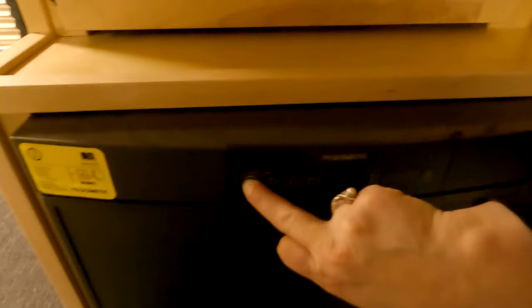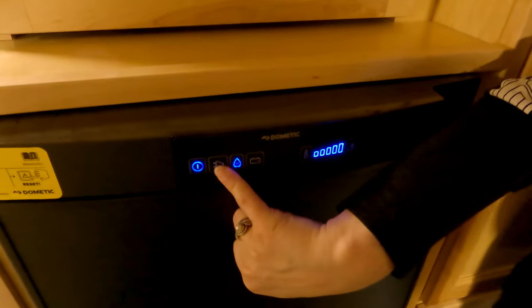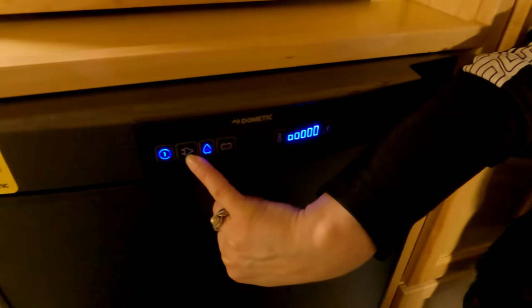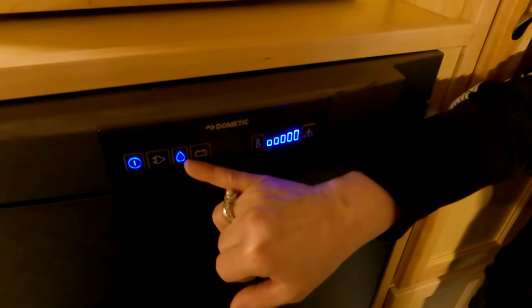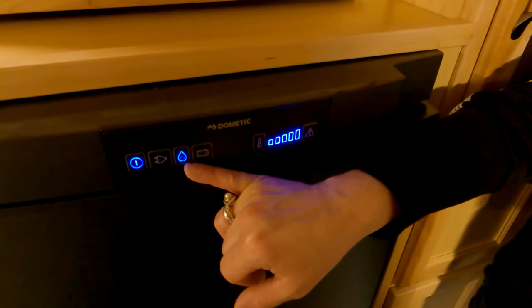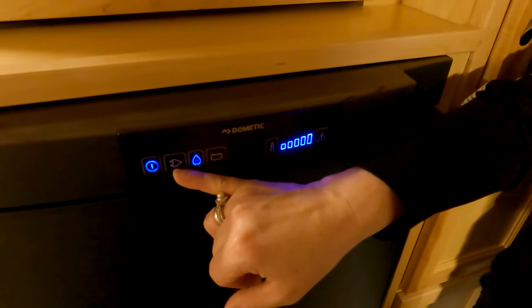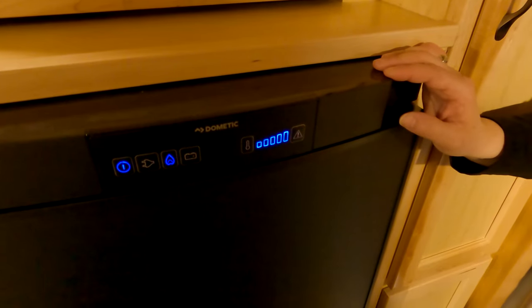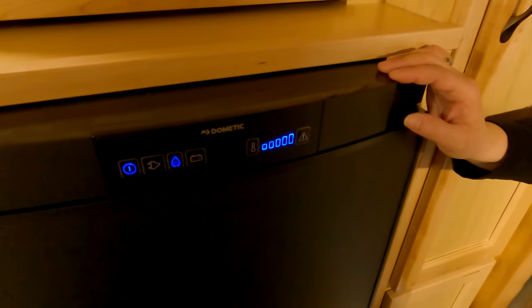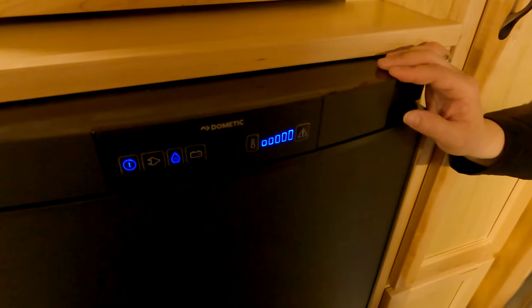This is your fridge. You're going to hit your power button right here — so now it's on propane. This is battery and this is plug-in. You don't have to go outside to light it; just hit this button for propane and it'll automatically light itself. Shore power is the best for your fridge. I don't recommend running it on battery — only for emergency use for a few hours because it will drain your trailer battery. Otherwise, when you get to where you're going, either plug it in or turn your propane on.